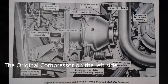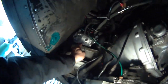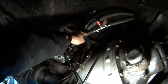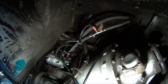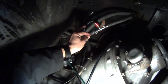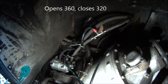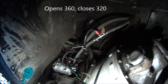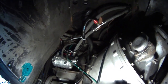Now I'm underneath the bus at the right rear corner. There's the compressor, and we added this high pressure shutoff switch — it comes directly off the high pressure line from the compressor. It's normally closed, so it completes the circuit, and it stays closed until 360 pounds of pressure. At 360 pounds it opens and turns the compressor off. Hopefully we won't have that kind of catastrophic failure again and I won't have to buy another new compressor.